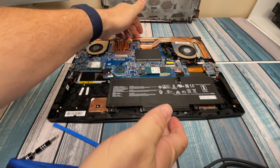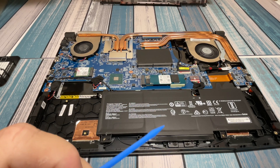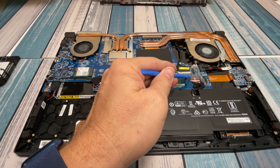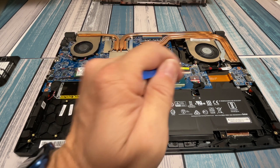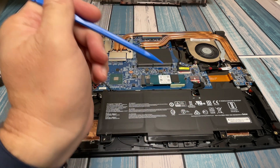Let's take a look at what we've got under the hood. If I was going to do any work, the first thing I'd do is take this connector off — it's connected to the battery. You want to disconnect the battery so that nothing accidentally gets powered up while you're poking around in here. You don't want to short anything out.